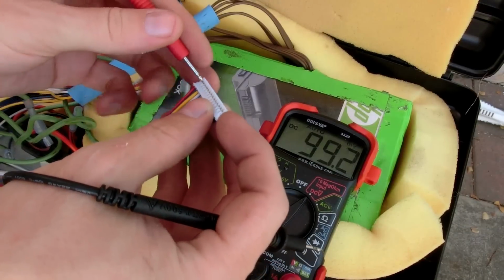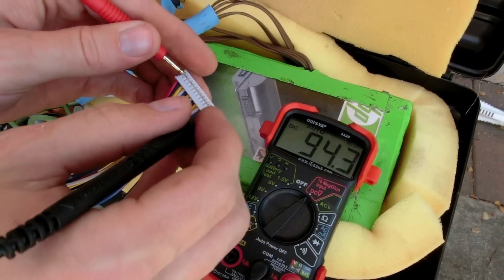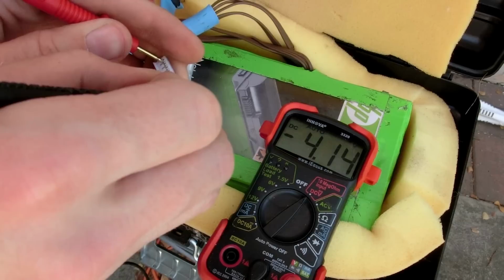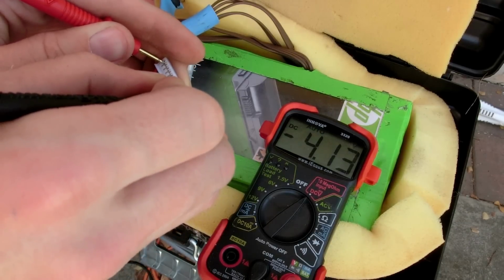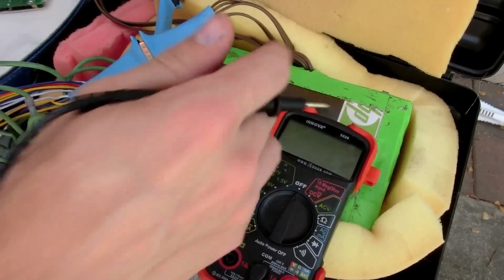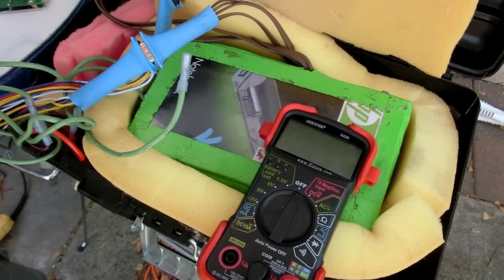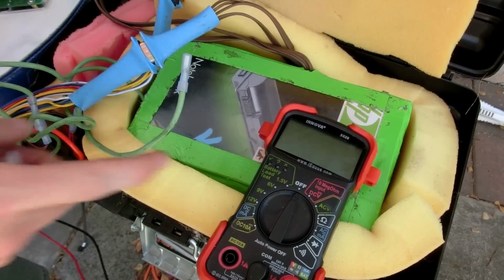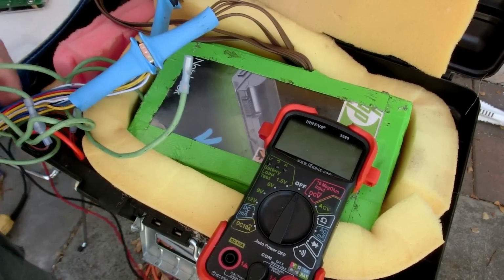So we should be able to test this and get 53 volts or so. Okay. So we've obviously made an error. We have 3 battery packs. We have 2 24-volt ones and 1 4-volt one. And it's coming up as 4 volts. That's because we must have connected it backwards. So each 24-volt one is canceling itself out.